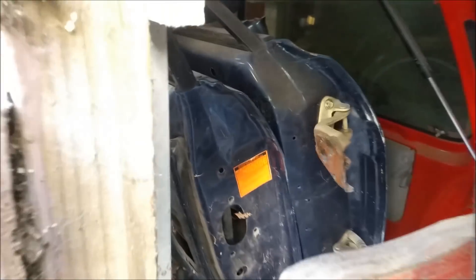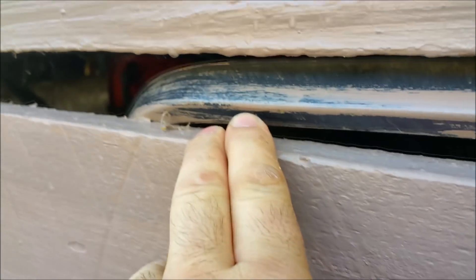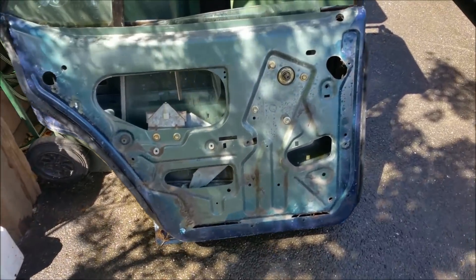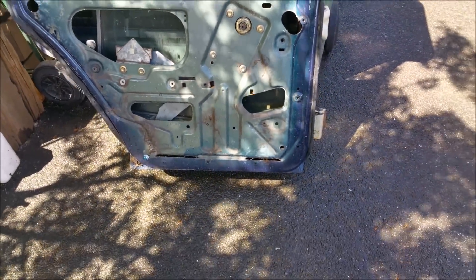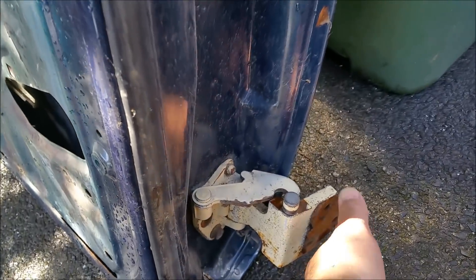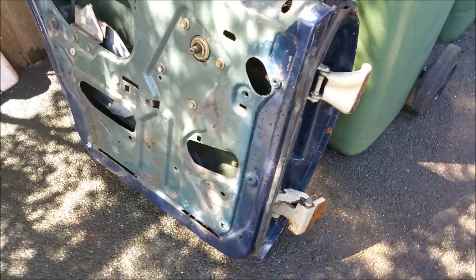So under my house there are the front doors, and there's a Starlet tailgate next to them. I've actually taken the back doors out. You can see I've started painting the tops of the front doors at the same time I painted the house. It's not quite the right colour, but I need to sort of improve the coverage here as well — I've sort of painted them into the house as well. But here are the back doors. Jen came out yesterday and it rained — not a big deal. So I think the first thing we'll do is pop the glass out and window regs. We're putting electric windows in this car, and the hinges are going to need rebuilding because they're knackered and the detent's all gone. We can get spring rebuilding kits.